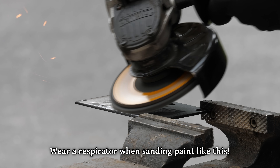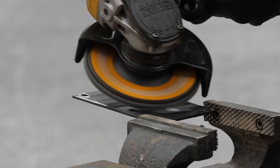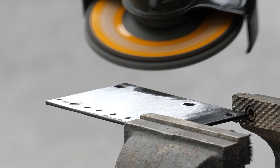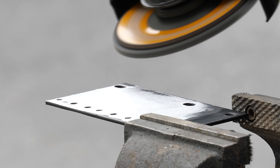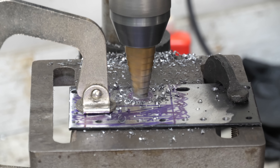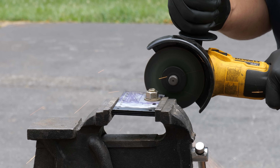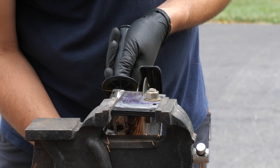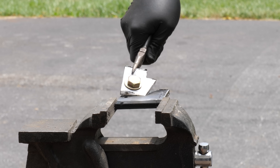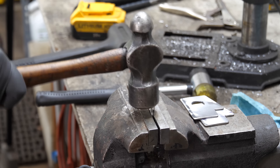The first parts we'll need to make are mounting pads to hold the polyurethane grommets and attach the fuel pump bracket to the body of the car. We're sanding all the paint off these eighth-inch thick steel plates — salvaged from some disassembled server racks — for exactly that purpose. We'll stack three plates together, scribe them, and start drilling for the grommet hole. Once through, we'll use a step bit to bring them all the way up to 11/16ths. Those get bolted together so we can cut them all at once. Once fully cut out and sanded, we'll clamp them in the vise one at a time and bend the sides up.